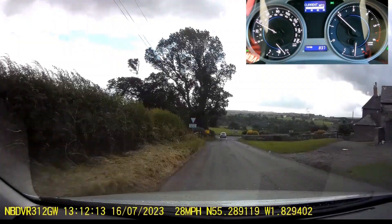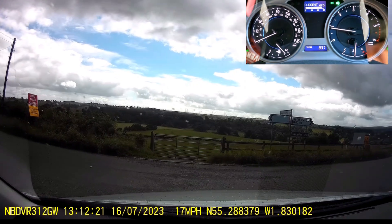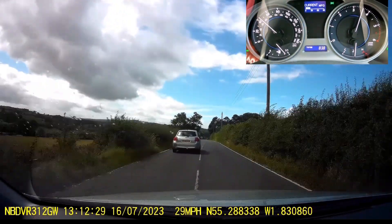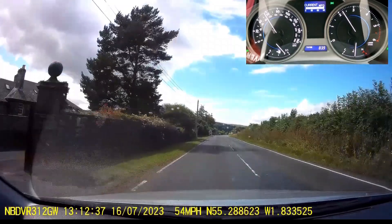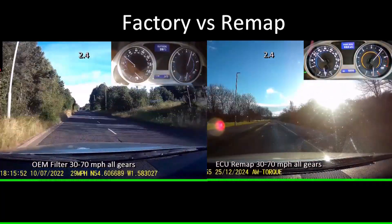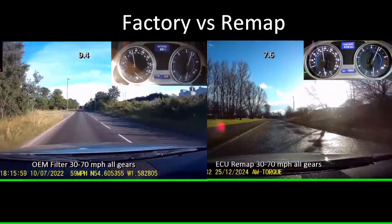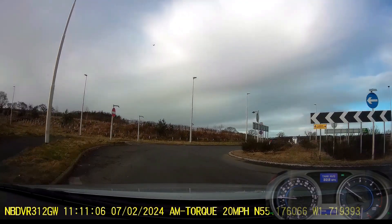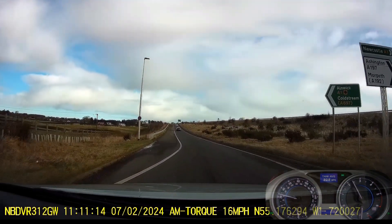Why did I focus on 30-70 times and in-gear acceleration as well as 0-60? To have a good 0-60 it relies on so many parameters — a dry grippy road, a good clutch, good tyres, a driver who can balance the correct amount of clutch slip with RPM. But a 30-70 can be done by any driver with any ability and doesn't rely on good traction off the line. If you want to compare real-world acceleration between two cars — or in this case two different tunes — a 30-70 through the gears removes many variables and lets you concentrate on engine power and drivetrain efficiency. And in real life, how often do you actually go from 0-60? You're more likely to go from 30 to 70 coming off a roundabout to join a motorway, or to overtake a slow tractor on a B road.